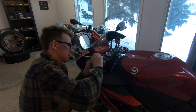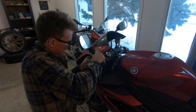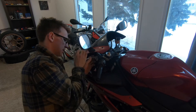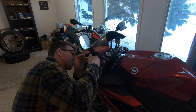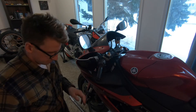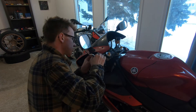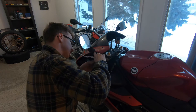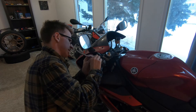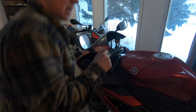That just slides out by the looks of it. This should just pop out as well — it's kind of tight. It's halfway out already. For some reason it doesn't want to pop out. Looks like the little pin that holds the cable has a rubber piece around it and it's wedging. So I'm gonna make sure it comes out very straight — there we go. So yeah, if you try to wedge it out it'll just get stuck, but pulling it straight worked.